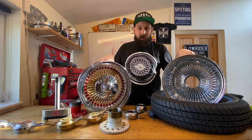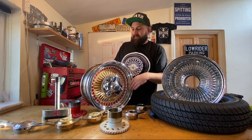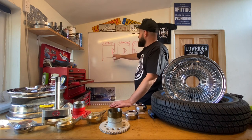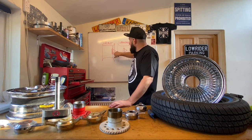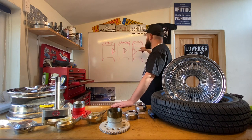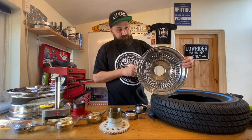The alternative to these two is front-laced wire wheels. The front-laced wheel has the lacing right up against the front lip, so it's designed for a front-wheel drive car — your more modern European or Japanese cars where the wheel won't fit under the arches. On the diagram here, you've got your front-laced wire wheels: that's your hub, there's your spokes, and that's your adapter. Your hub sits right up against the front side, a bit like a front-wheel drive car. Your standard lace is more central. If you're lucky enough to fit reverse, which in my opinion are the best looking of the three, the spokes are laced right at the back of the wheel to give you that extra dish.